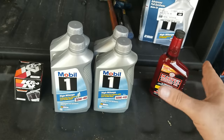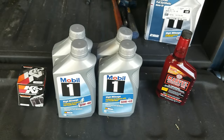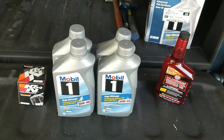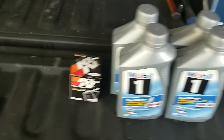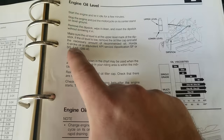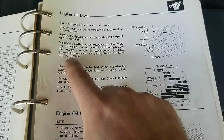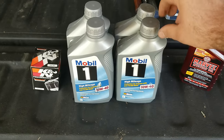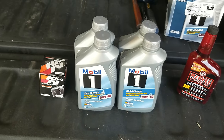You don't have to use Marvel Mystery Oil — that's just me. I'm explaining all this because I'm sure I'll get tons of questions about why I'm using synthetic or 10W40. But even in the Honda book it says 'Honda four-stroke oil or equivalent, API certified,' and it does say 10W40 — so they really recommend the 10W40. I use this same oil in my KZ2 with no problems.